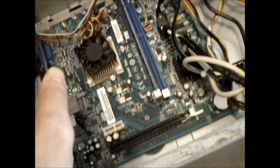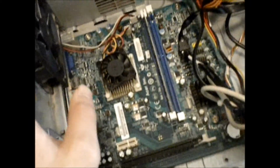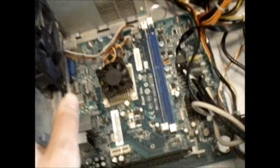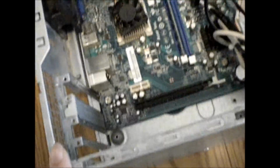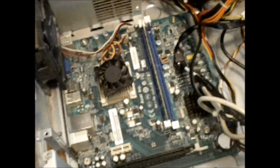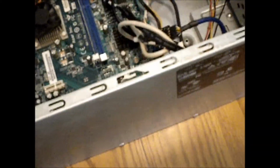I am going to add probably more RAM in it because it's running Windows 7, and 2 gigs just doesn't cut it. You can select how much video memory you want dedicated from the RAM, and right now it can go up to 512 megabytes, but I have it set to 256 just so that Windows has more to play with. My original plan for this thing was to use it to run a virtual machine, which I had it doing, running 2 copies of Windows XP. I was going to do that for my virus testing, to see which antivirus is what type of thing. Because I've done it before on single-core machines, and well, it wasn't too great. So, yeah, it worked okay on XP, but it definitely needs more RAM.